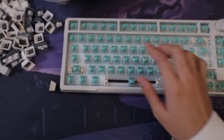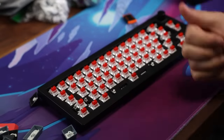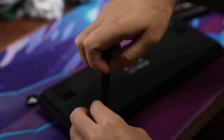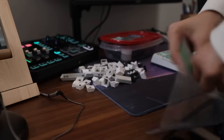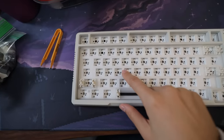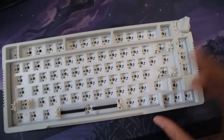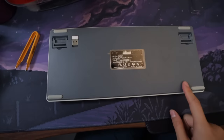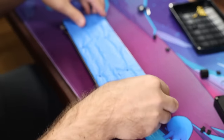I'm not going to use any of these switches — they're quite loud, although less loud than his keyboard. Let's get this keyboard taken apart. It pops out. It's tape modded from last time — forgot about that. The switches are off. It already has bungee stuff for the spacebar, so the sound damping is actually quite nice. The stabilizers are pretty nicely lubed, so there's not much I need to do.